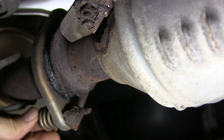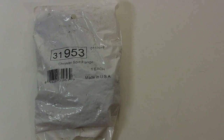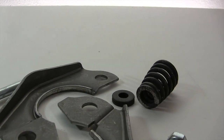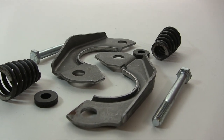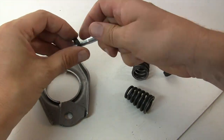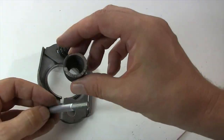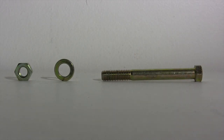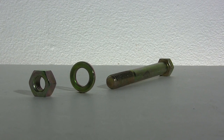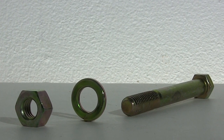The lower bolt has totally given up. The flange on the center pipe is actually still okay. Introducing flange repair kit number two. The kit comes with plates, springs, bolts, spacers, but no nuts or lock washers. Having seen the original bolts rust out so badly, I decided to upgrade the fasteners for this flange kit to a larger, one inch longer, grade eight yellow zinc plated set with nuts and lock washers.